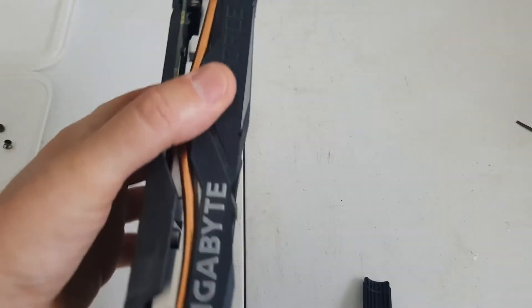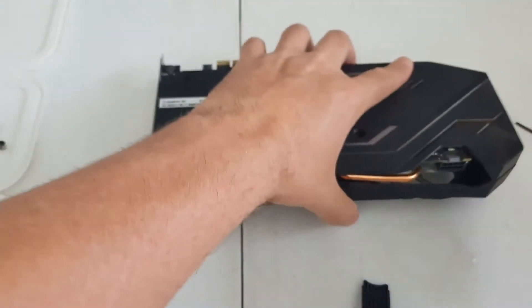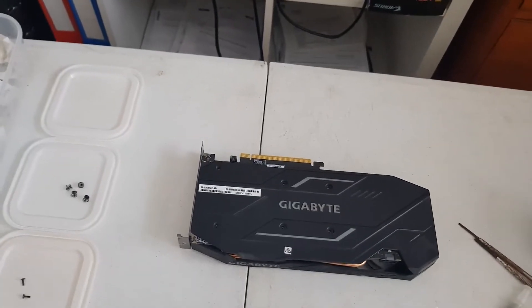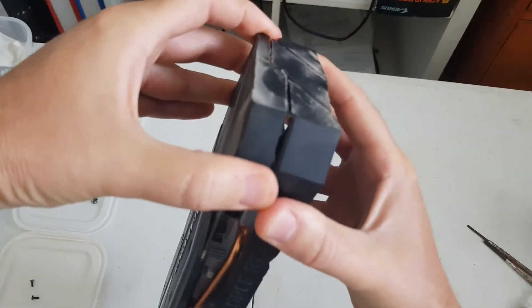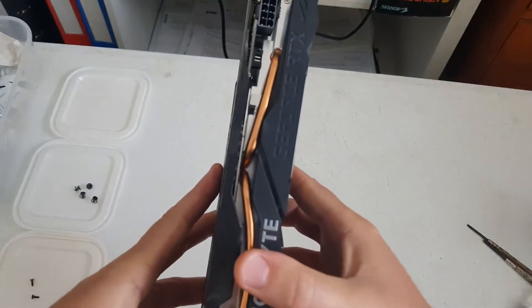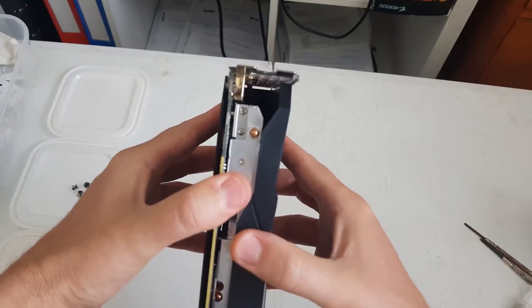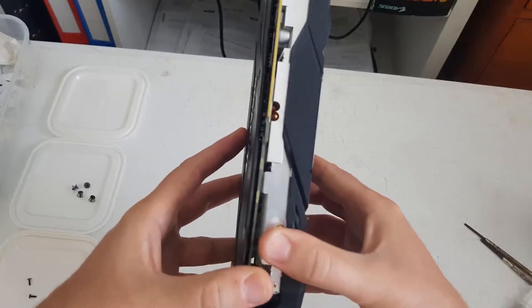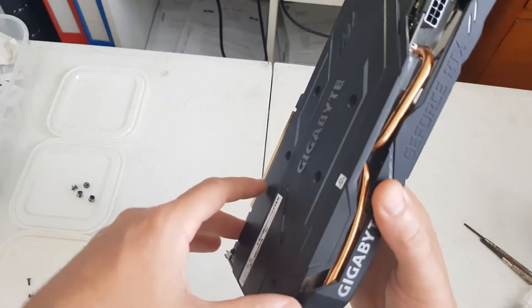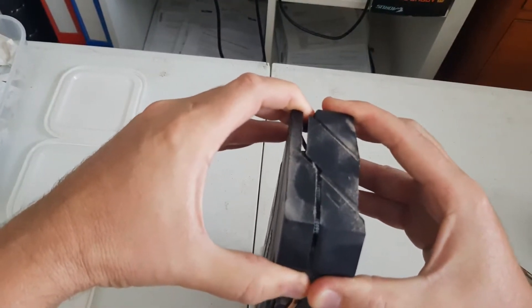What you need to do then is prise it open a little bit — there are two pieces here. There are two plastic grommets that clip into each other. You need to gently work them apart. Be careful as you do this. There is a fan connector inside which we'll take off once we get it a little bit more open. You can see the back plate is kind of loose now, but there are two screws which go through the other side of the back plate.